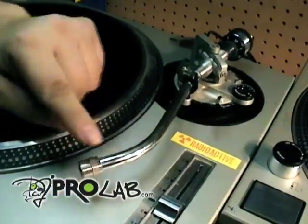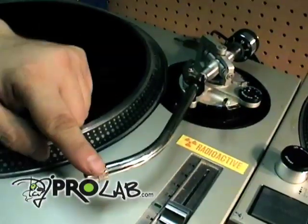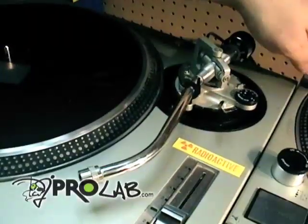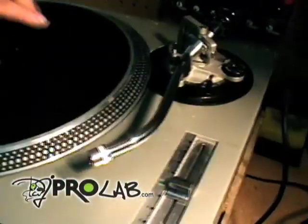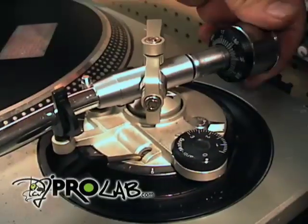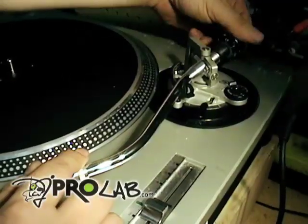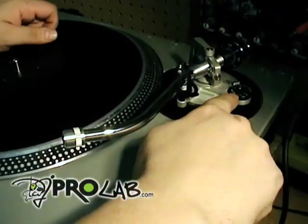I'll also go into how to test if you have good sound coming out of the tone arm connection, but that's in a later project. Now I'm going to show you what a bad tone arm does. This tone arm — same thing. We took off the cartridge. We put the balance weight all the way to the rear without taking it off, just as far as it'll sit. Let go. Anti-skate is at three.